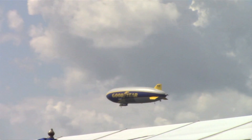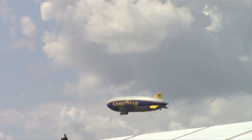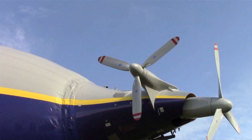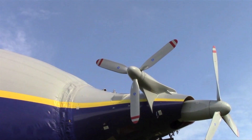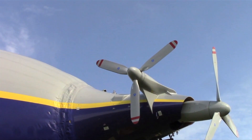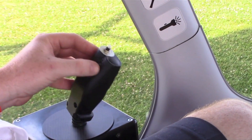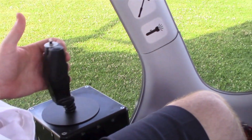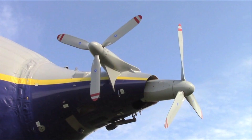We can do vertical takeoff, vertical landings, and if need be we can still operate much like a conventional airship. On our aft engine we have two propellers, and this is one of the things that really makes this airship unique compared to other blimps or airships. One is the lateral fan which controls thrust for left and right in the yaw direction, and the other is set up as a pusher motor. It can also rotate down 90 degrees to control the pitch of the aircraft during takeoff and landing.